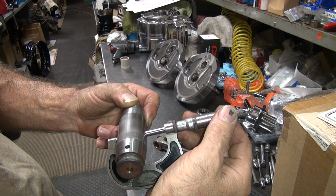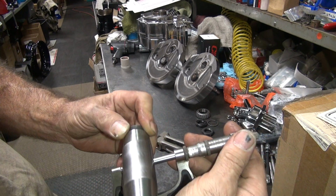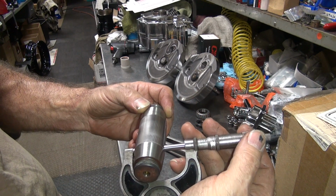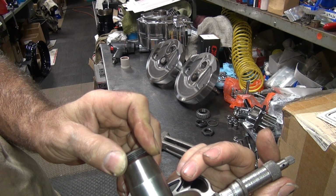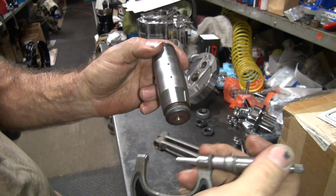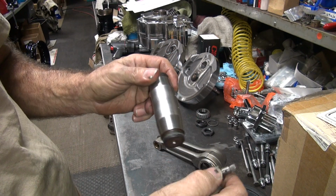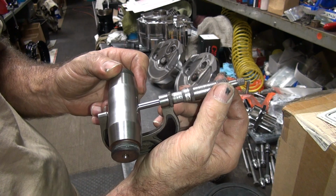Nine again. Okay, well, actually reading the gauge, not too bad. 8. Alright, well that looks a lot better. So we had about a 1/10 and a half variable in this thing, which, for them, is not too bad. 1/10 and a half I can live with. It's way the hell undersized though. So that's one. We were 7 8/10 under, but we were a full thou under, so it's 1.2, 1.3 thousandths undersize.